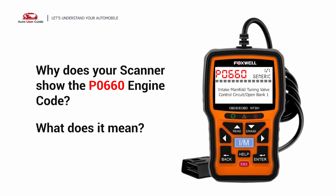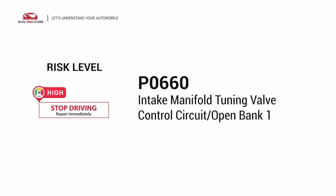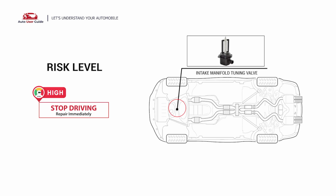Why does your scanner show the P0660 engine code? What does it mean? P0660 is a diagnostic trouble code for intake manifold tuning valve, control circuit open at bank 1. It indicates a problem with the intake manifold tuning valve or its associated electrical circuit. Under this circumstance, stop driving and repair your vehicle immediately.